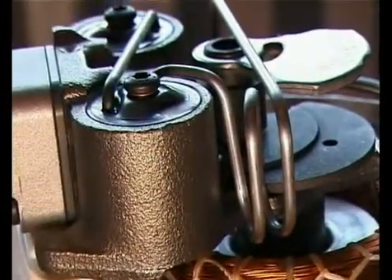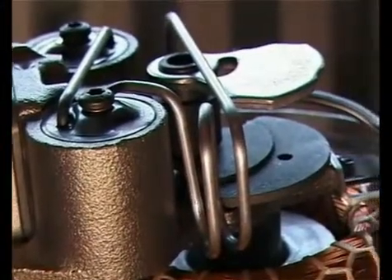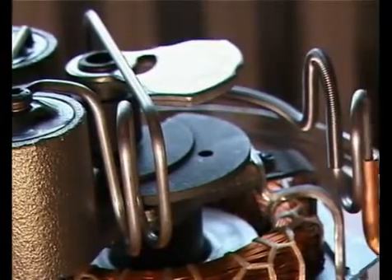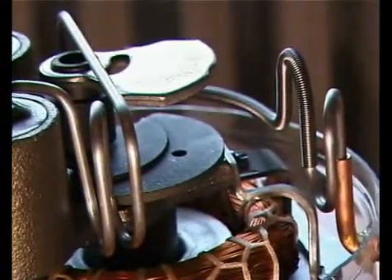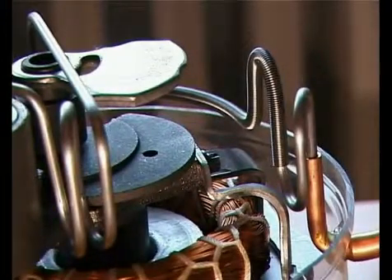The block has two discharge chambers. From these chambers, the compressed refrigerant passes through the discharge tube to the discharge connector of the compressor. The turns of the discharge tube increase the flexibility of the tube — they minimize the oscillations of the pump unit and prevent the tube from breaking during operation.